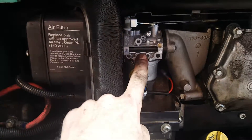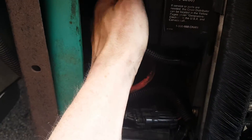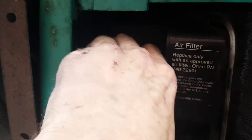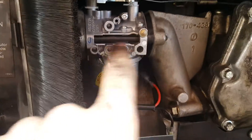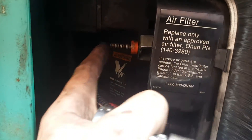Here's the air cleaner, here's the carburetor and the little inlet manifold. What you have to do is take this wing nut off first, then take the air cleaner out. This is how tight the space is — you tip the air cleaner towards the back, then go around the nut and out. Inside here there are two 10-millimeter bolts. I used a deep socket with a three-inch extension and a one-inch extension, which puts me exactly past the air cleaner studs so I can get both bolts out.